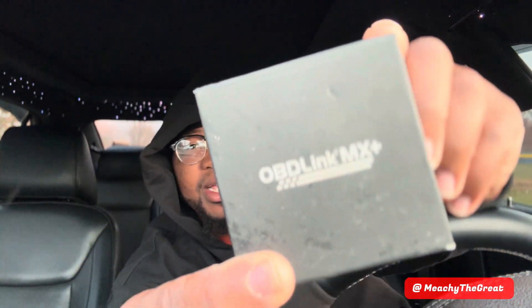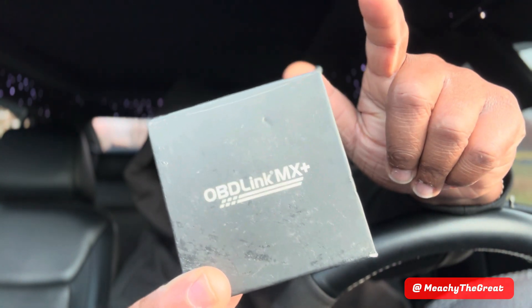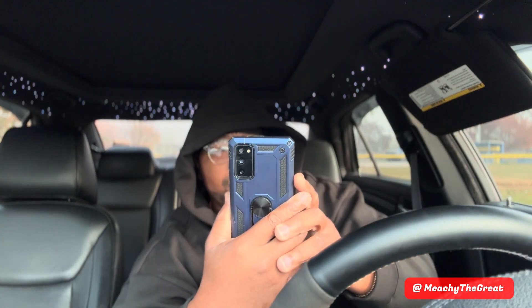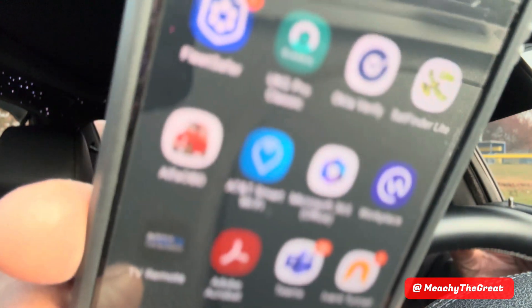That's how you do the cluster swap. You can find the OBD Link MX Plus on Amazon — I'll leave the link below. The app is Alpha OBD — it's a little red beetle icon — available in the Google Play Store or on computer. I recommend doing it on the phone since you don't want to lug around a big laptop. Also with this app you can get SRT pages and unlock a lot of factory-locked features that these cars come with.